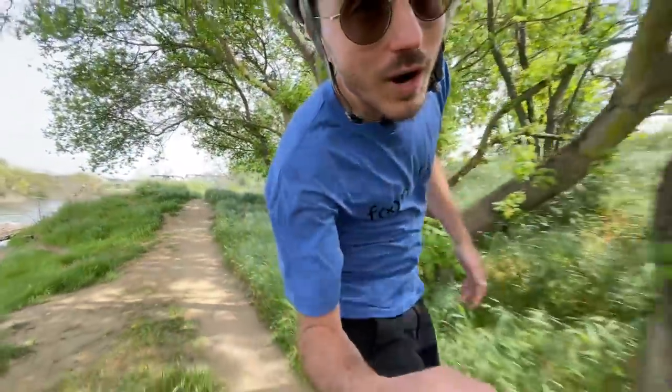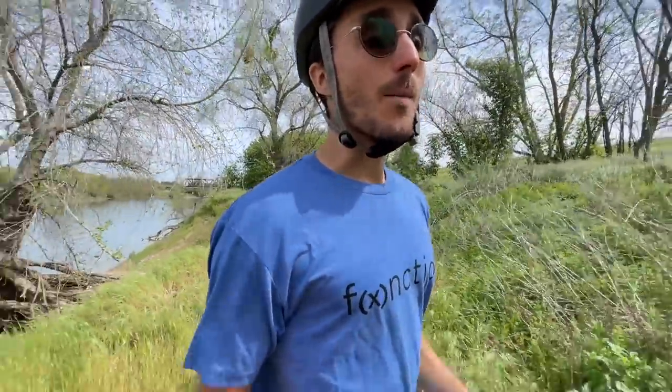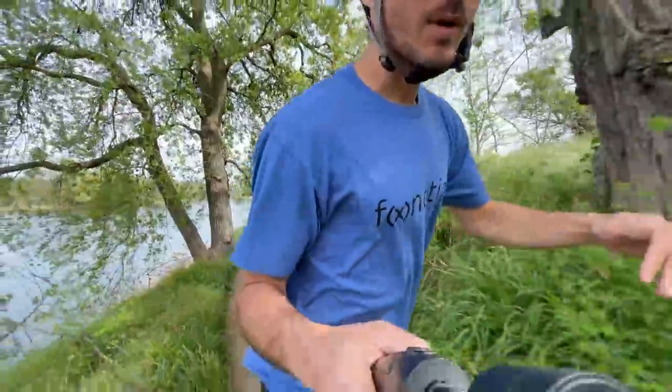Basically when I would get a new Plus or XR, I would ride it just to make sure there were no issues with the battery — because that is something you'd definitely want to get serviced under warranty if there were bad cells. But as soon as I started hearing a little bit of a rattle, I would take that ferrite ring out. Some of my friends would hot glue the ferrite ring to the edge of their controller box.